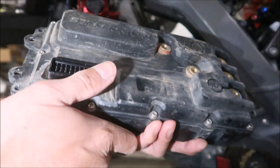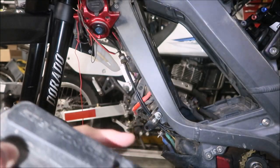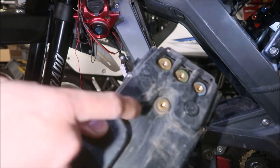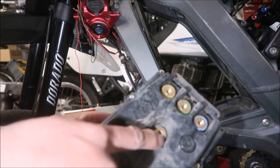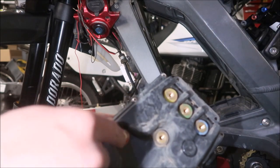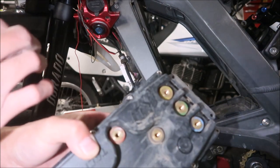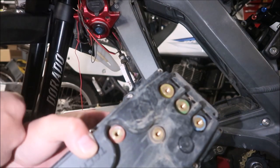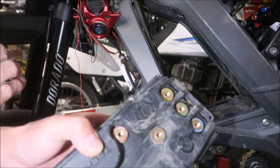I've uninstalled the old controller — the shrouds are off too. It's pretty easy to take out; there's a big gaping hole in the back. I used a wrench to take out the terminals, but you shouldn't — they're very weak and easy to damage. You should use a screwdriver. One thing I noted when I took the phase cables out is they were a little loose. Every once in a while you should poke behind the controller and check if they're tight.